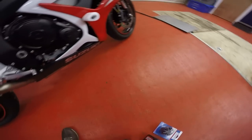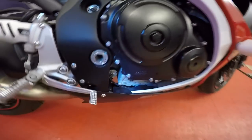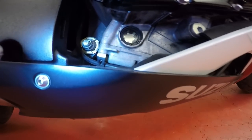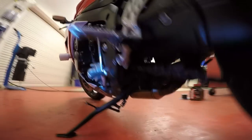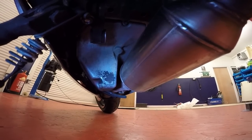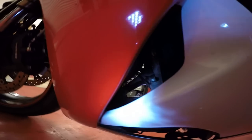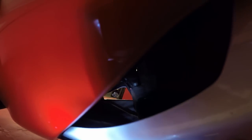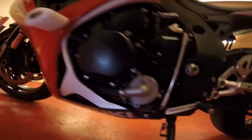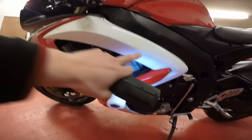I'll show you a few of the bits on the bike. You've got your filler cap there for when you fill it up, and your sight window for your level just down there. If you come around to the other side, you've got your sump bung just under there, and the oil filter is just under this left-hand fairing — it's quite difficult to see, but you can see it better when the fairing is off. Some people struggle trying to do it with the fairing on, but I'm going to be taking this left-hand fairing off today.